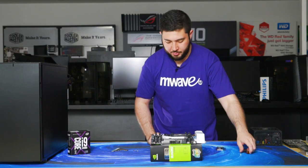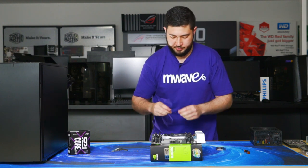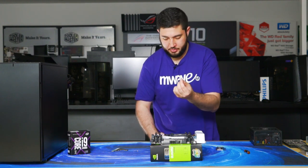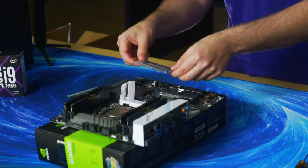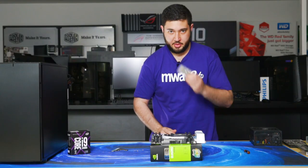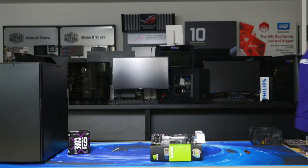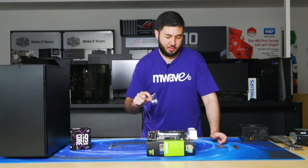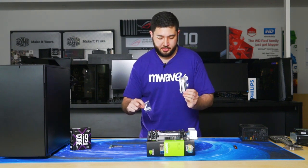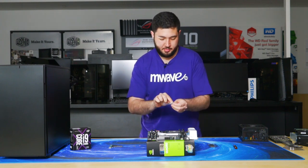Okay, so inside the motherboard box, there'll be a very, very tiny screw. It'll be the same gauge as this screw, but a lot shorter, and that's to secure the end of the M.2 in the slot. So we'll just have to step away for a moment just to grab that. Okay guys, so we went to the motherboard box to find the screw that we need to install the 1TB NVMe drive. It comes with this little standoff, so we'll install that first.